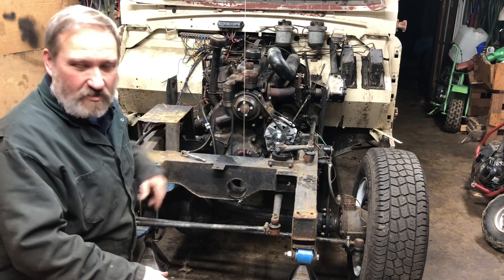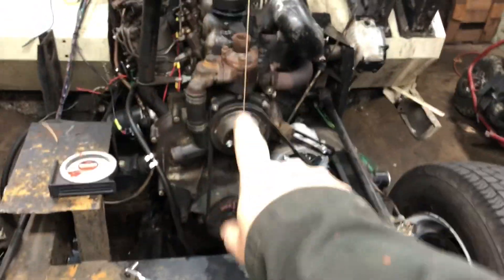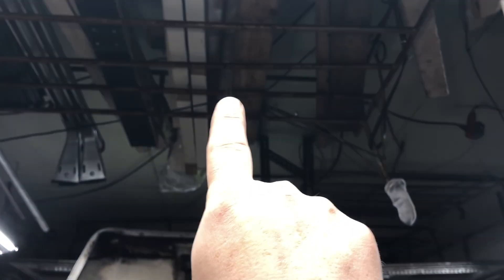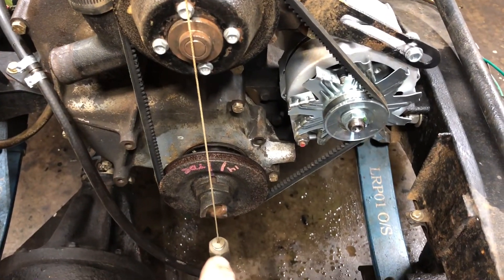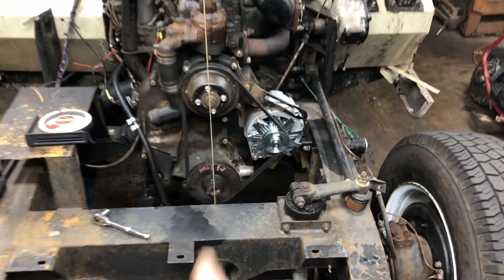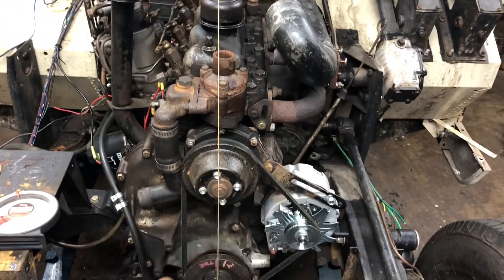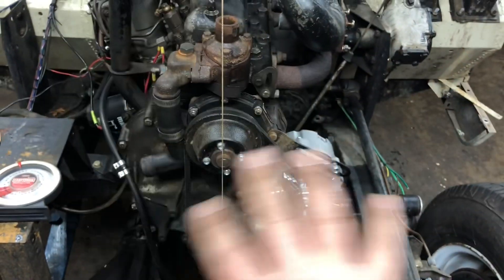The first thing I did — you can see I have a plumb bob hanging down from the ceiling, and it's lined right up with the dead center of the crank coming down. So I have the center line of the engine marked with just a plumb bob hanging straight down from the ceiling. That should get us our center point of the crank, so when we put the other engine in, we know where our center line will be.